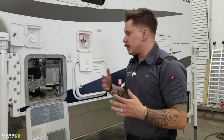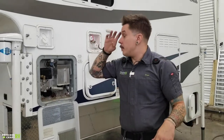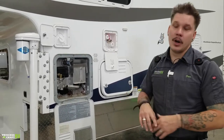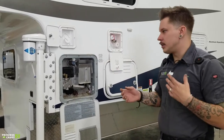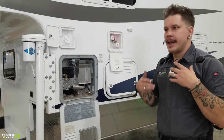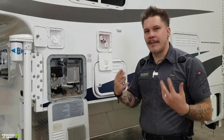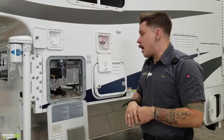To prime it, it's going to sound similar to depressurizing but essentially the exact opposite. If we're going to introduce water to the unit via potable water, we'd flip on that 12-volt water pump. For city water, physically turn on that valve or reconnect that hose. With water now present within the unit, go to the hot side of any fixture and turn that on. This time we're going to see that flow be very interrupted, very airy and spitty — it's displacing the air and refilling with six gallons of water. By the time that flow normalizes at the fixture, that is your indicator that you have a full six gallons of water within the unit and you can start heating your water.